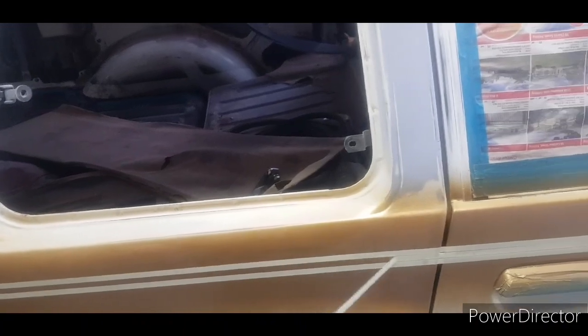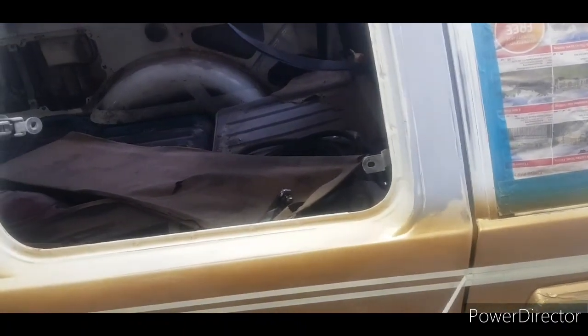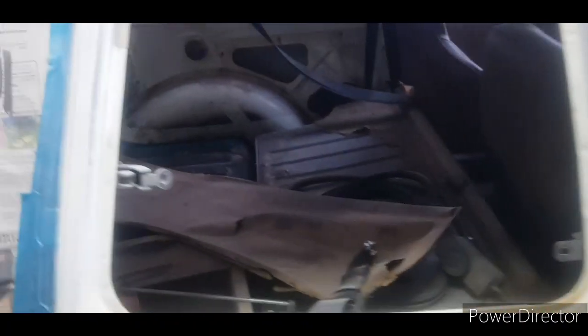Right, so you can see that there's three layers. So I've got all of them down, or the other way down. But you make sure you put a good firm push on your line too, because it will start separating if you don't do it properly. And also, see when I take this off, bang, I've got my two lines masked that I want gold. So what I'll do with this excess is use it on the other side, so I don't waste anything, but also I'll use some to do inside the doors.